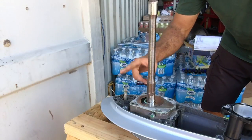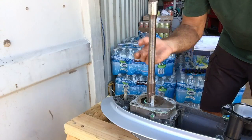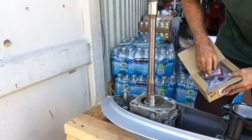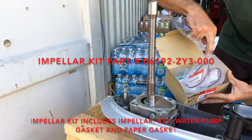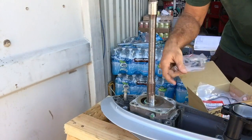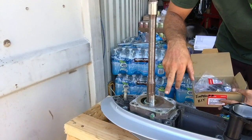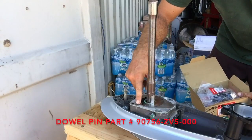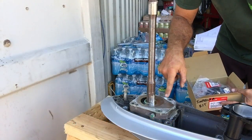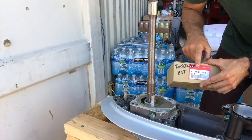This is your shift shaft right here, and this is obviously your main propeller shaft. If you need to get in here to do work — like maybe your gear case is leaking — you're going to have to take the shaft out, which I can do in another video if there's enough interest. I usually have plenty of backup, so I'll take a whole impeller kit with the impeller — got spare gaskets and even the spare metal ones. You're going to probably have to bend this because there's so much corrosion around these little pins. I'd recommend buying some of these alignment pins — they're all the same part number — because these get so corroded and will be your problem for getting these things off. I ended up having to heat it up and burn these gaskets. Just get the whole impeller kit, which doesn't come with some of the gaskets, so watch out for that.